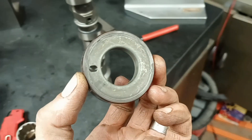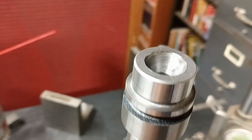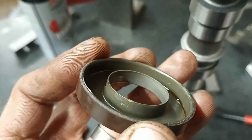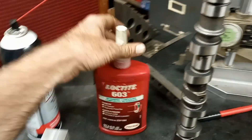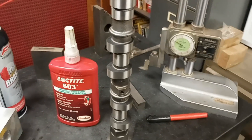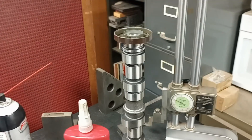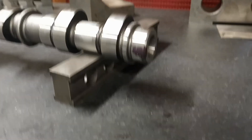We've got our reluctor ring off. We had to use a bearing separator and be really careful - this thing is super thin, it bends super easy. But now you can see we've got a timing mark in here that I created, and there's another one I've created. We're going to set this up, line it up, and press it back on. I'm using a socket so we're pushing on the hub, and I'm putting Loctite 603 on this when I put it on to make sure it doesn't slip later.